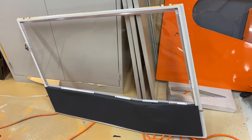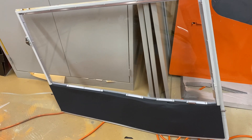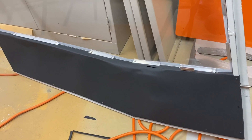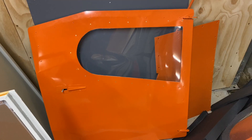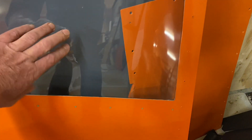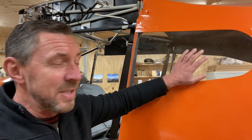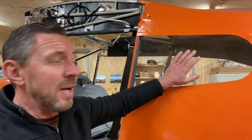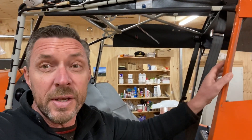I've done quite a lot of work on the front doors. Rather than having two separate doors, I've welded them together to make one gull wing door and I'm very happy with how it's come out. It has a Kydex panel on the inside, with the acrylic pane now fitted, and the mechanism works very well. The forward cargo door also has the acrylic fitted, riveted in place. I've installed the rear passenger window on the left side — also acrylic rather than Lexan, since acrylic handles chemicals better. It's not as strong impact-resistance-wise as Lexan, but still nine times stronger than glass.